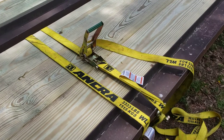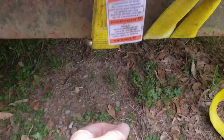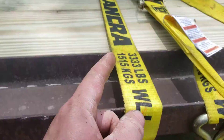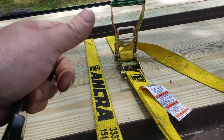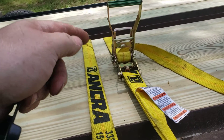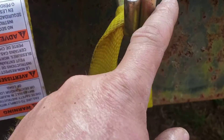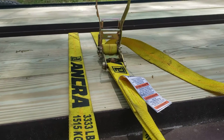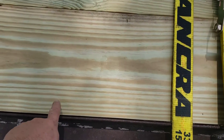Another good way to straighten the wood out on the trailer: you can hook your strap here, run it up, drop the end of the strap down — not the part with the hook because it won't fit sometimes — just the little strap part. Bring it back around, loop it around here, and you can just ratchet it on down and it'll tighten the wood right up.